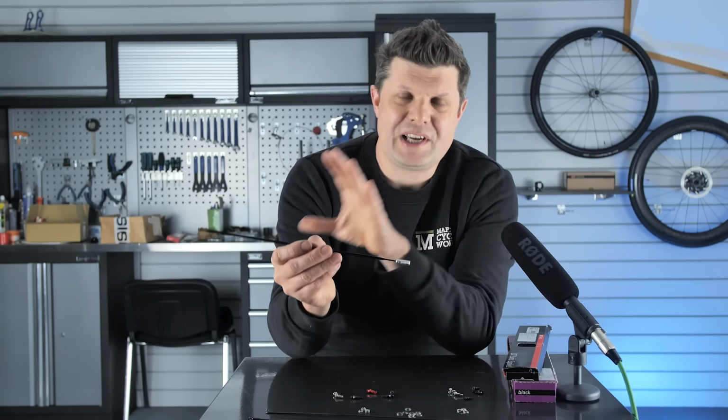Like we've seen. Brass is definitely more durable. For a small weight sacrifice, I think it's nearly always worth opting for brass nipples, unless you're really prepared to look after your wheels, really meticulously clean them, get all that salty road grit off them and look after them, in which case you can save just a few grams.